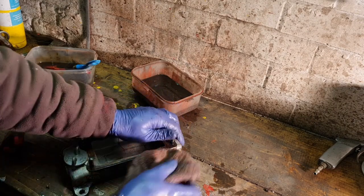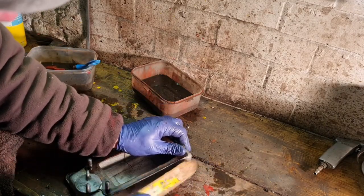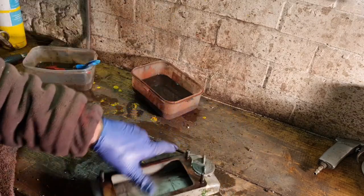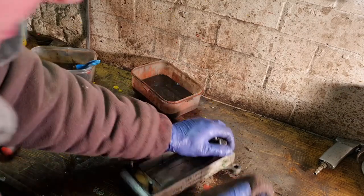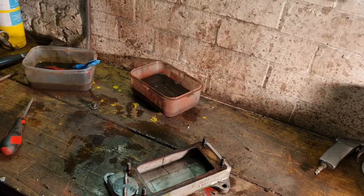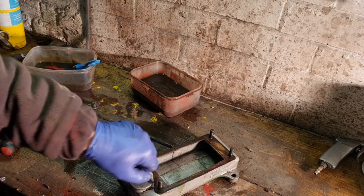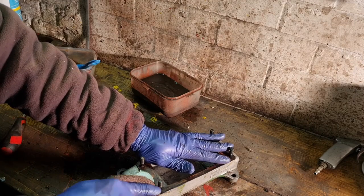Yeah. You buy the pattern gaskets. Yes, they're all right. They're not as good. They're nowhere near as good as the originals. So if you're taking original gaskets off to replace them with new ones, you're basically downgrading your engine, in my opinion. You're wasting money downgrading your engine just so you can say, oh, that's been rebuilt with new gaskets. Trust me, that's nothing to write home about. If your gasket's leaking and you've got no option, fine. But if she's not leaking and you're just replacing it because you're rebuilding the engine, why even bother?